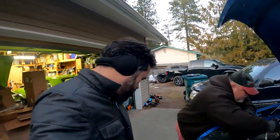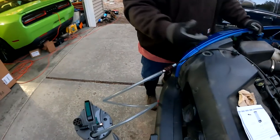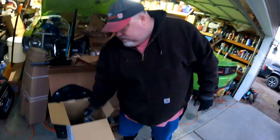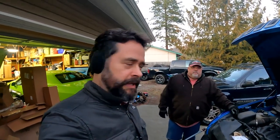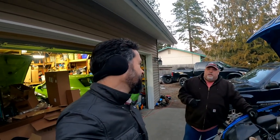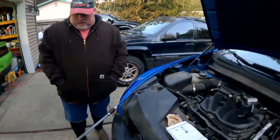We're trying this for the first time. There are multiple hose colors — black for oil, blue for water. They also provide an adapter for bleeding your brakes. We had tried a smaller one on the Raptor that did nothing, but it turned out the Raptor brake lines had an internal flap acting like a check valve — we had to change them out. Anyway, back to the task at hand. There are two ways this extractor can function: you can hook it to a pneumatic air compressor, or use the hand pump.